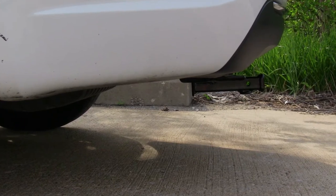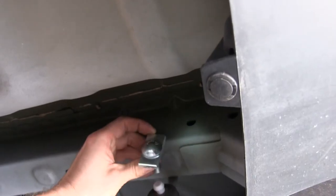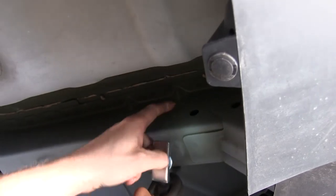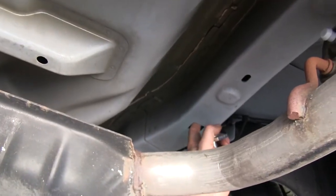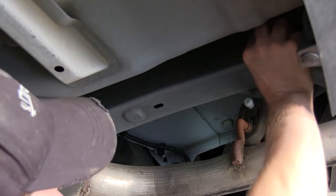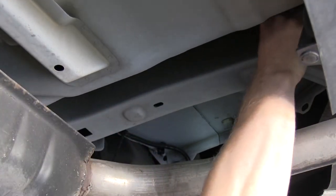Now I'll go ahead and show you how the hitch is installed. The first thing we need to do is fish wire a couple of bolts into the frame. We're going to install the small block and the inch and 3 quarter carriage bolt, pulling it through this hole in the frame using the fish wire tool that comes with the kit, and pull it through this access hole here. We're looking at the passenger side of the frame — it's going to be identical on the driver side except there are a few more components attached to the frame.